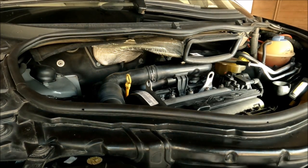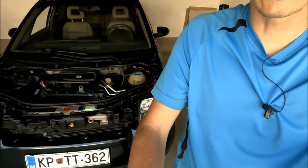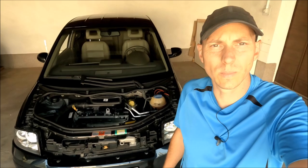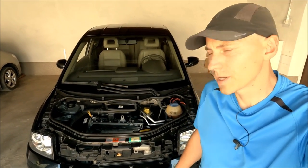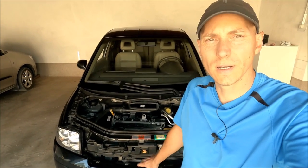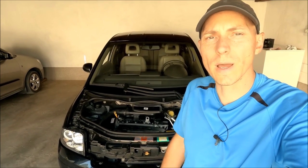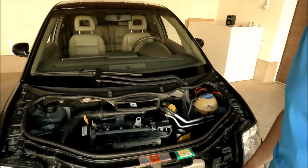This job was not really hard but it takes some time. Be careful about that seal — I lost it and needed to raise the car, take off the plastic under-tray, and it took me at least 20 to 30 minutes just to get it back. The rest is quite straightforward with the right tools. Now you also need VCDS or another diagnostic tool to adapt the throttle body to its new clean setting.